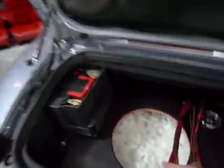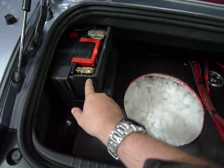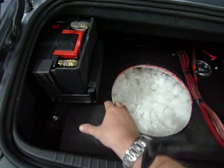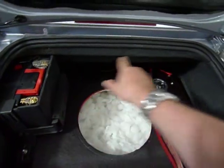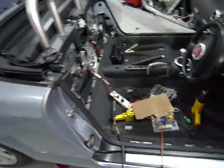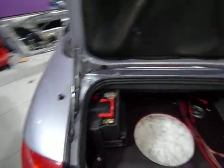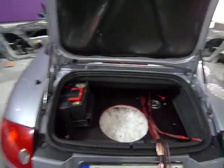This will all come through the back, and then you've got your cable length here. We'll run one primary cable to the rear battery, this will go to a very solid chassis ground underneath, and then the individual positive cables from the battery will run to the amplifiers, which we'll show you a little bit later on. So this is where we're up to at the moment — this is sort of day one on the build. We've got everything stripped down and most of the wiring done now, so we're just getting ready for assembly. I'll shoot a little video for you later on and just update you where we're up to once we've got the amp and the stereo out and a few other bits and pieces. We'll speak to you later on, bye bye.